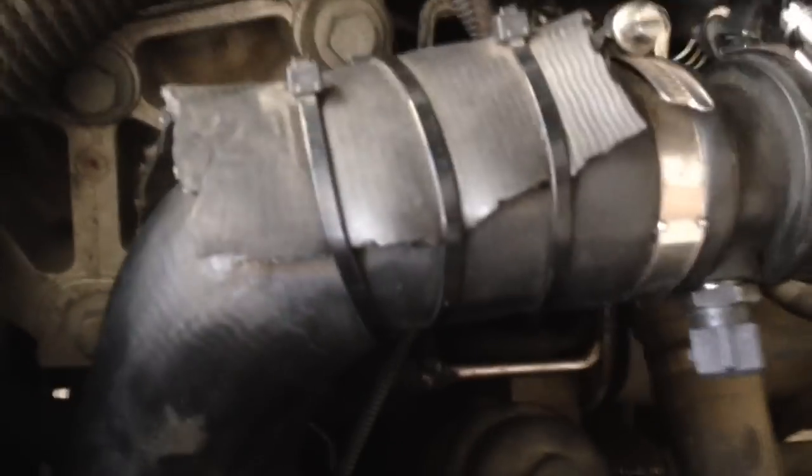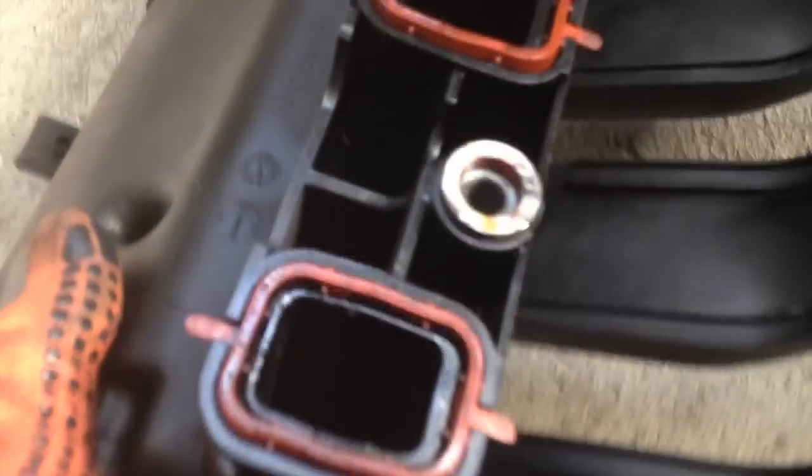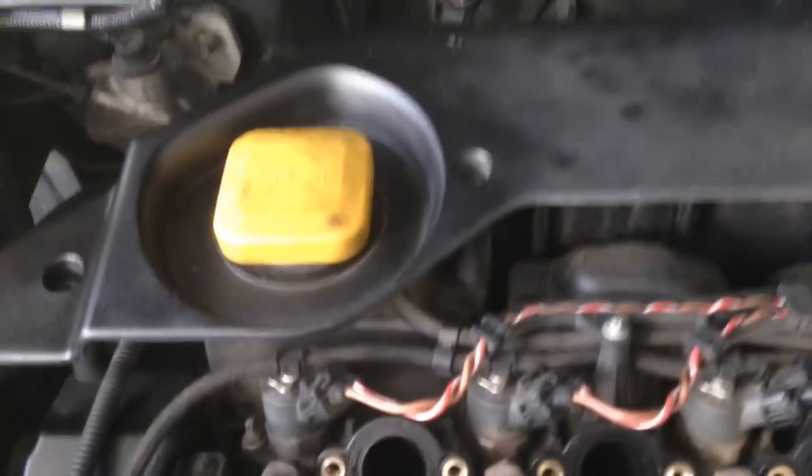Your model might have this connector on here, and there's another sensor over here. You're going to press that in and pull it down. You can see inside — I recently cleaned this one so I'm not going to do it this time, but usually it's full of gunk from the EGR valve. Next job is this plastic thing here — one, two, three, and there are two more behind. Five 5mm Allen bolts again. Remove the cap and put it somewhere safe, make sure nothing drops in there, and then we can get at the air filter.